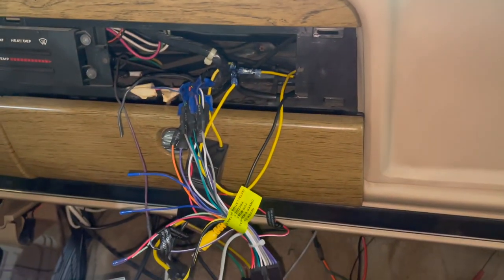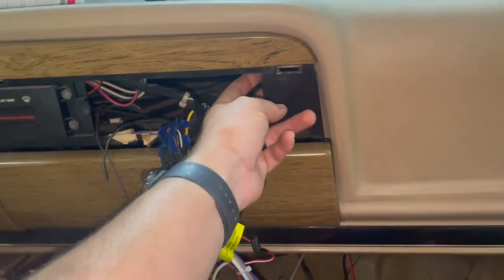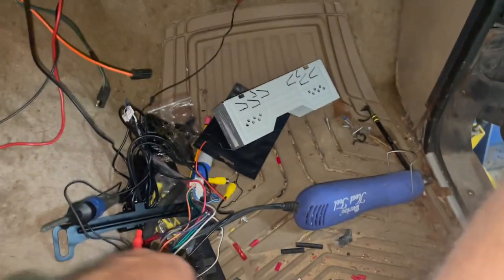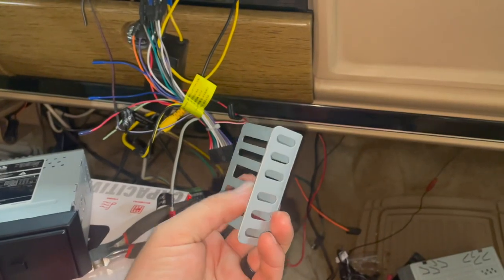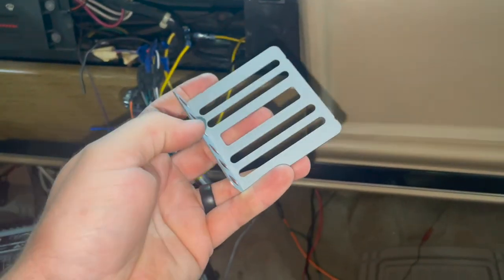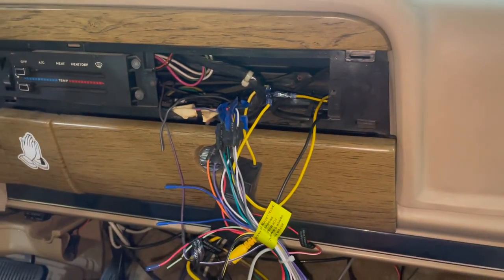All right, so to mount this thing — I'm not familiar with how the factory radio was in Wagoneers. The hole here is way too big for the sleeve to fit in like you normally would. But they do give you these brackets, and that's how the other radio was hooked up. It had this one with a tab in the front to hook to the mounting screws, but that won't fit on this — the holes don't line up. They send you these that we'll have to cut so they'll fit into these recessed grooves here. So I'll get the cutting wheel and cut these, and then they will screw to the side. And that's kind of cool too because we can set our depth a little bit, and that will get it mounted.